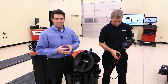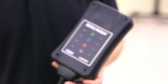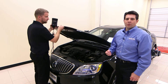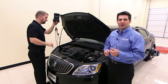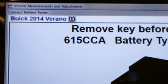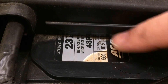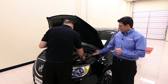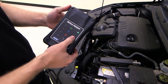The very last step of the inspection process is to verify the cold cranking amps of the vehicle. We're going to utilize our Hunter battery analyzer for this. Prior to inspecting the battery health, we need to verify a couple of things. First, verify that in the top left-hand corner we're showing the proper make and model of vehicle, and second, verify that the cold cranking amps displayed on the screen match the cold cranking amps that are on the battery. Once those are verified, we simply install the clamps red on red, black on black, and verify on the screen that we have a blue light.